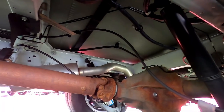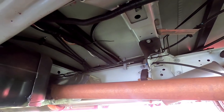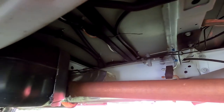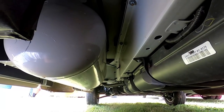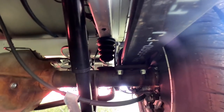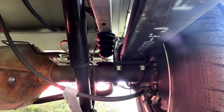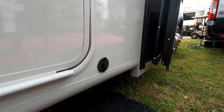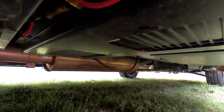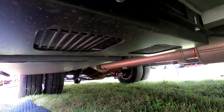The fresh water tank is 30 gallons, in an insulated enclosure — that's good. The tank flush line was not insulated, so no flushing the black tank when it's freezing. Overall there wasn't much extra clutter under the rig — thumbs up on that. The large propane tank is visible from underneath. The bump stop in the center of the frame has lots of clearance, indicating the suspension is not overloaded. The battery box has a 300–330 amp-hour AGM battery.